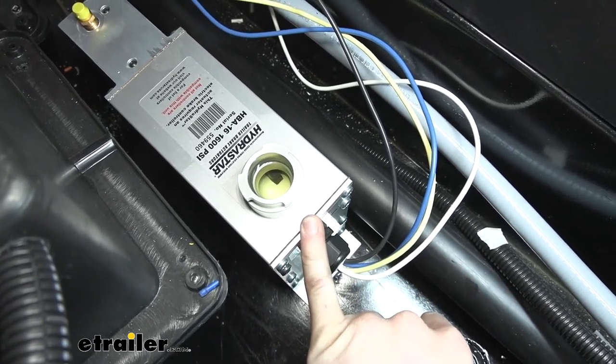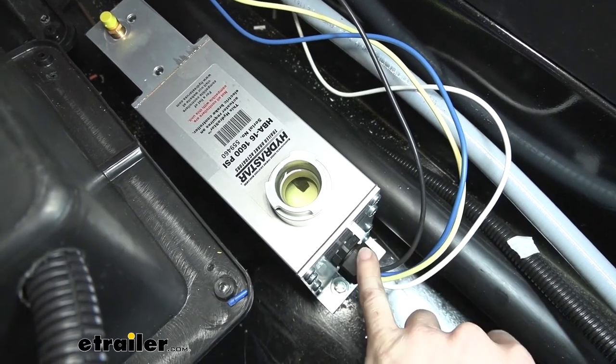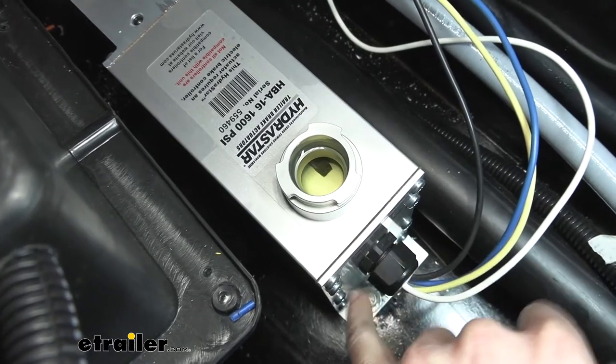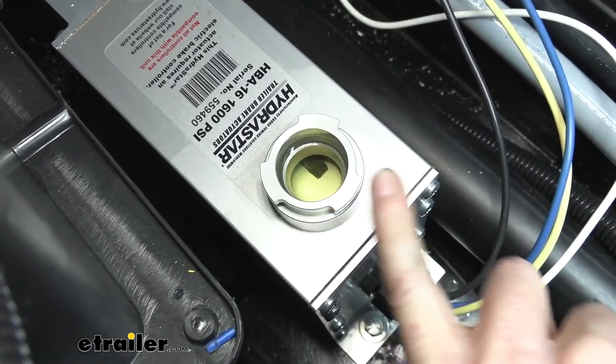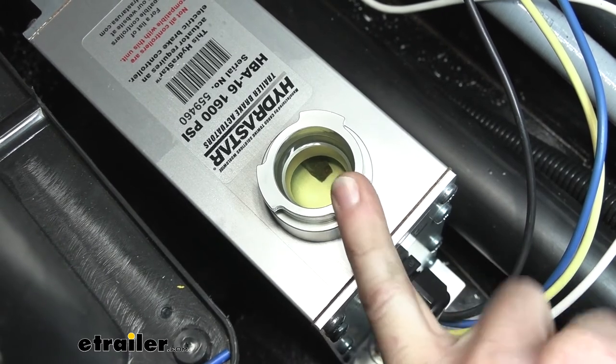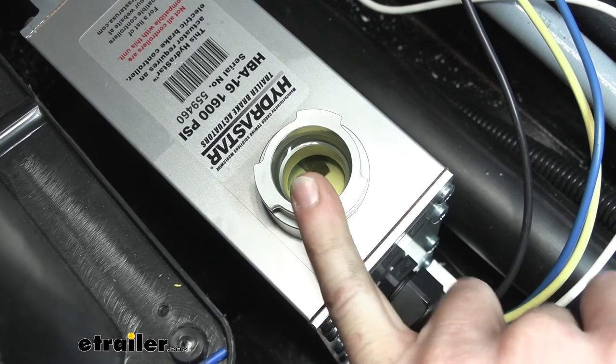And now we're going to have an assistant up here at the front that's going to monitor the fluid level. If you drain the fluid down too low and it drains it dry, you'll have to start the bleed procedure all over again because it sucked air into the system from the very beginning here. Your assistant's also going to top it up, make sure it stays full. And it's nice if they're up here at the front because they can pull your breakaway switch pin for you to activate the brakes when you're bleeding them.